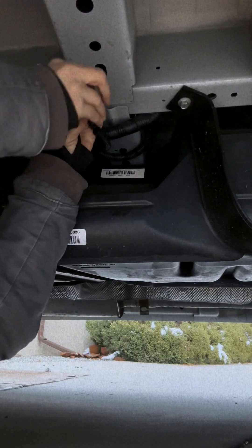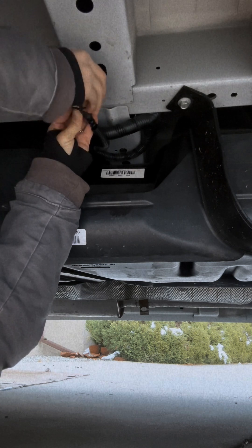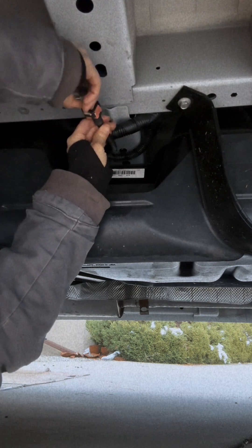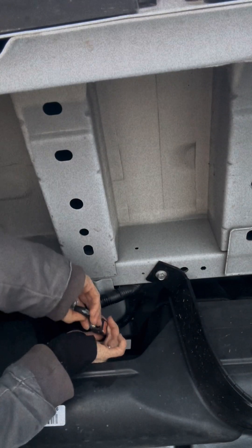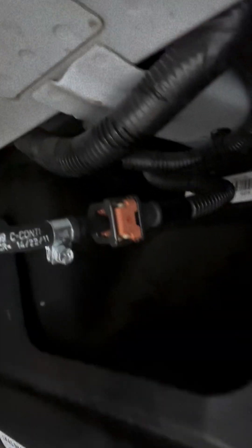You still need that red piece because that's how you lock it back in place. I've got that snapped back in — yep, it's locked in place. I did get gas on myself, so you should definitely wear your safety glasses. Now I've got that red piece locked back in place and it's inserted — it only goes up to that first ring; this little in-between part just kind of sticks out. Now it's connected — give it a tug — yeah, that's not coming out. It's not leaking, except for what I already got on myself. So that's how you connect to the auxiliary fuel port extension line.